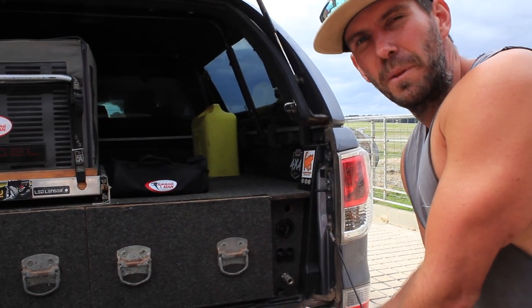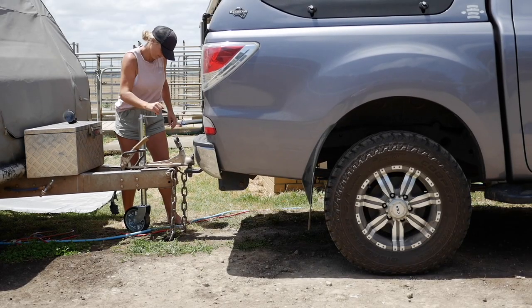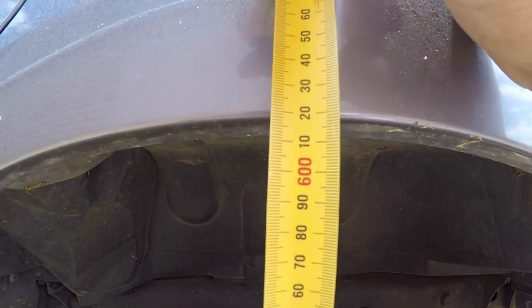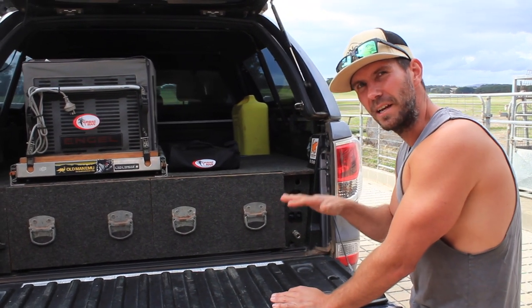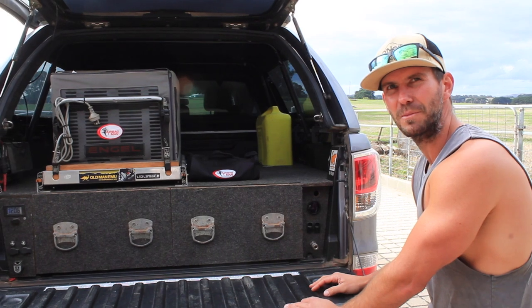In here you've got a gauge for left and right for your airbags. From the previous video, I know the maximum I can put in my bags for this vehicle is 40 psi. To get my ride height back to level where I need it when I put the caravan on, I only need 32 psi, so I can watch this on the gauge. Up goes the car — the compressor kicks back in because the pressure's dropped in the tank — and then top them up a bit more. There you go, 32 psi in each bag. How easy is that?